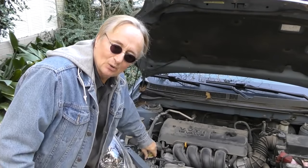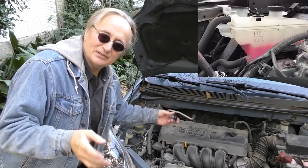So if your heater's not working right or if it's just going weak, check your coolant and fill it up to the top — could be as simple as you're just low on coolant. If you are low on coolant, check it at least once a week to see if there's a leak you need to keep adding for. Some people never check coolant — if the car is three or four years old and you add some and the heater works great, now if it keeps going down, you've got to find out what's wrong. Cars all have temperature gauges, so if you have a serious cooling system leak you'll see the temperature gauge starts running warmer. If you add coolant and get heat and everything works fine for weeks or months, you fixed it by just adding coolant.